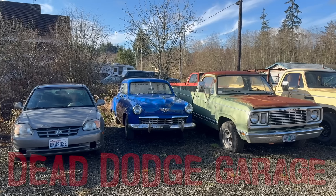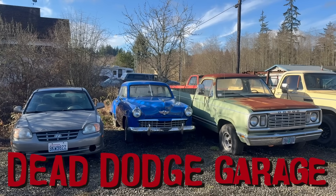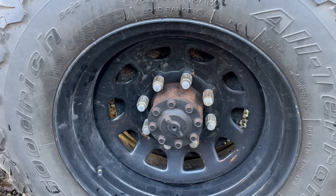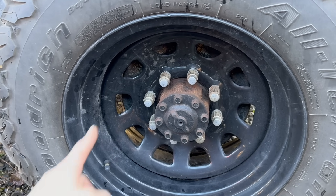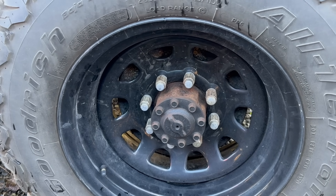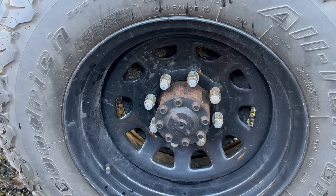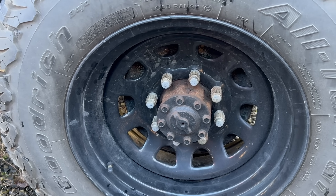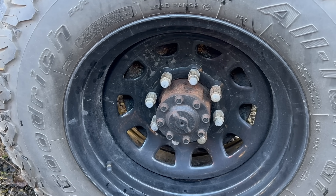In the beginning — and I'm talking way, way back — there were cable-actuated brakes. These generally would have been a drum-type brake, not at all unlike these, that were mechanically actuated by a cable. This cable might have been attached to a brake pedal, or it might have been attached to a lever, depending on the design of the vehicle.